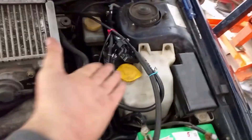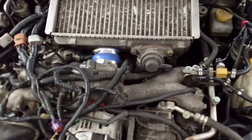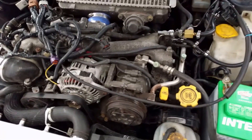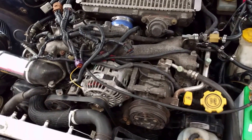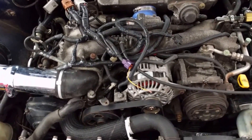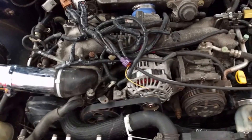So to run the flex fuel sensor, I'm just going to reharness over and clean this up. The signal line can come right through — there's already 12 volts and ground all around in here, those are easy to find. We just did the hardest pin. Next time you're looking to run something to your ECU, that's how you do it. Those things are like 20 bucks on Amazon — go get one. It's worth it.